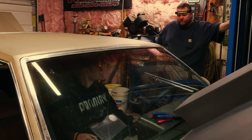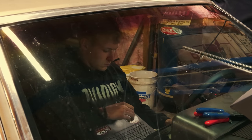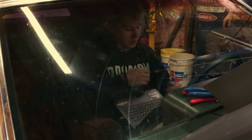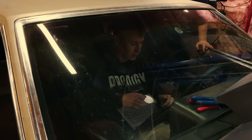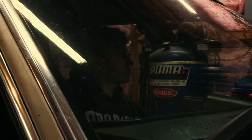Yeah. We'll just set it to leave at like 3,400. It'll take 3,400. I know it will. It'll probably take 37, 38. Okay. So we'll leave the ignition timing in it until 3,200 and we'll start pulling it out. That way it drives around and doesn't slobber and idles fine. If it goes to 3,200, then it'll stay out of the nitrous.